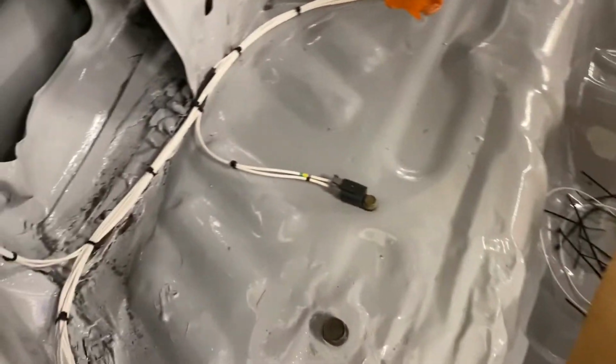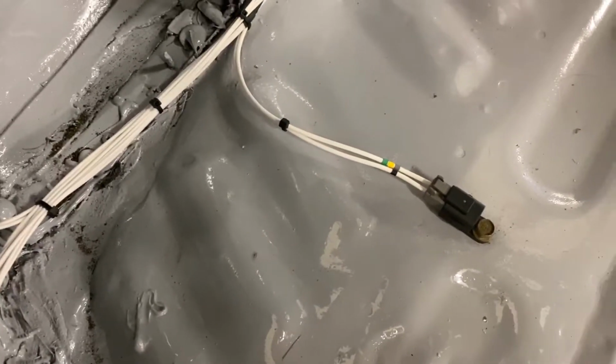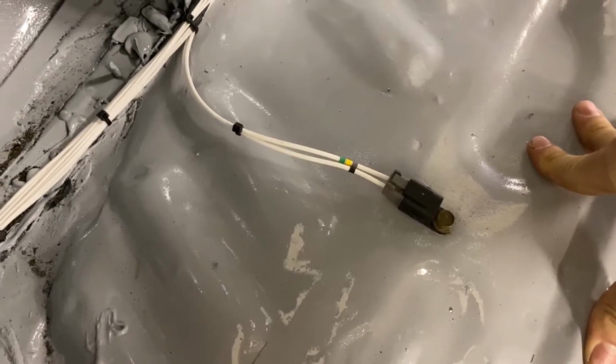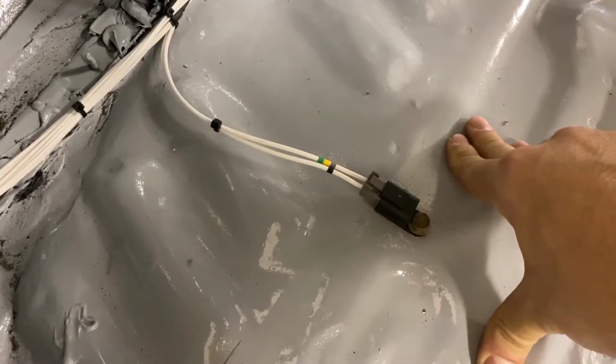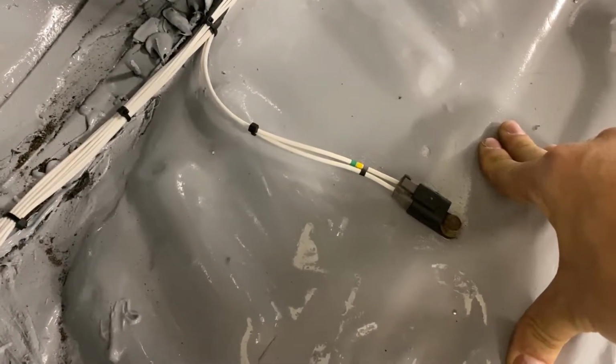So come back, the next breakout here, this one's interesting. I think it might be worth explaining. This is actually for fuel pump 2. So I know I've mentioned in the fuse box the relay is not there. It's so that power doesn't come back here, even though it's fused. If you don't need the power, don't send it. So that's a pretty general rule of thumb.